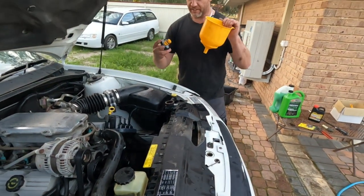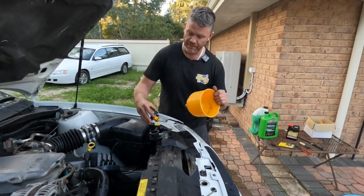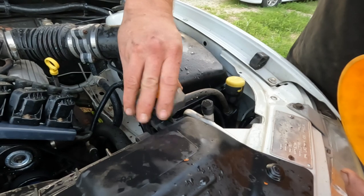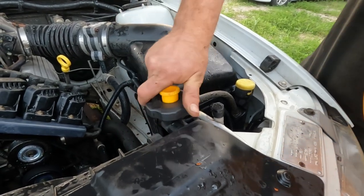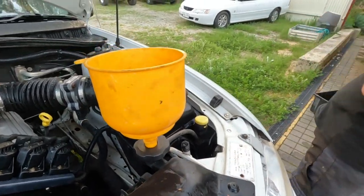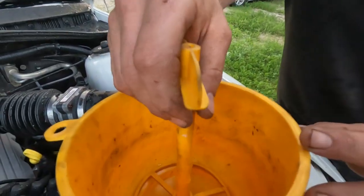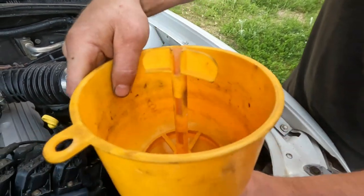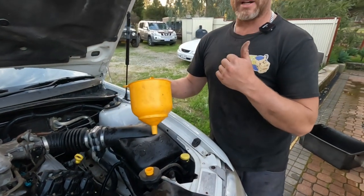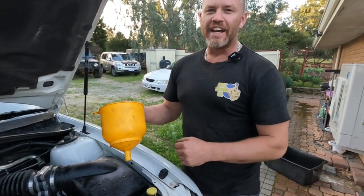I'll fit this coolant bucket - that handy tool, an eBay special. This is basically similar to your radiator cap. It goes down, in, it's got the little locks. Then this coolant bucket goes in. It does have a stopper, so once you've filled it up you can push that down and wriggle it, pull it up and save all that coolant - spill a little bit, but definitely a thumbs up for me on that one. Now we'll fill it up with water and that coolant flushing additive.